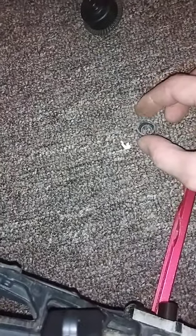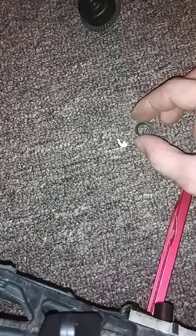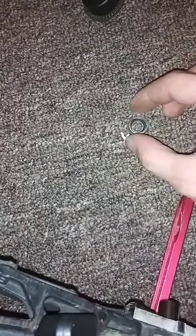This shim will actually push the ring gear over some toward your pinion. Of course, that way it gets a tighter mesh. I use about 2 to 3 of them. It just depends on the bearings. I have a brand new case right now I'm fixing to put on, and with it I'm going to have to make a little modification to the case to where I can shim it up tightly, or not tightly, the way I like it. That I call it tight.